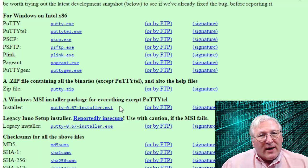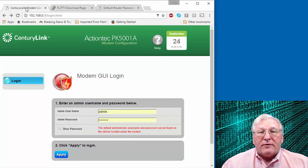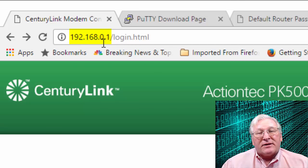Let's talk about your home router. You have a router or a cable DSL modem — all of these work approximately the same, though the screens look different, so you may need to fish around a little bit. The first thing you need to do is find your router's address. It's going to be one of two things: either 192.168.0.1 or 192.168.1.1. On rare occasions it's something else — you might call your ISP if one of those doesn't work.